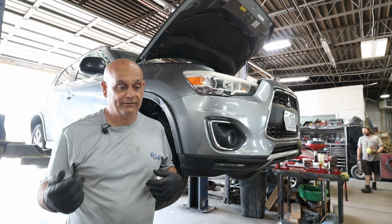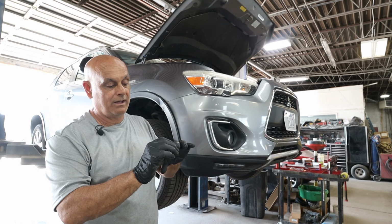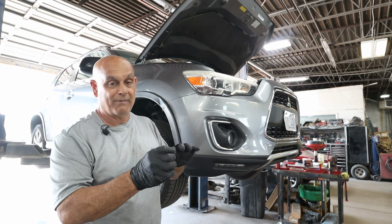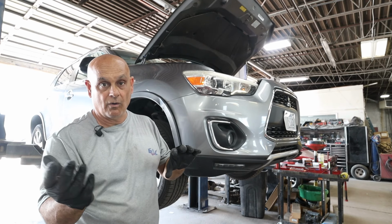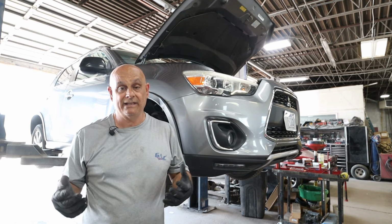And what I found was, on the AC compressor, as it was running, every once in a while, it would throw Freon out by the compressor, very little bit. And my sniffer would pick it up and of course go off. So I called her up and told her, basically your compressor's leaking.